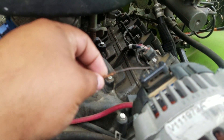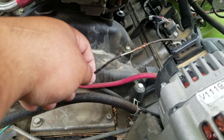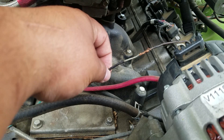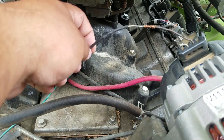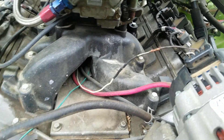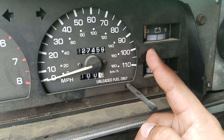It's just kind of barely hooked up together, but it's going to be the brown wire — the second wire. This brown wire goes in and hooks up to a 470 ohm resistor. This resistor then gets connected to a wire which goes to my ignition switch.